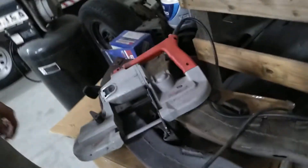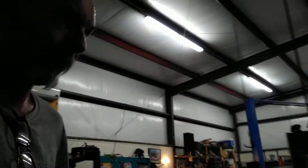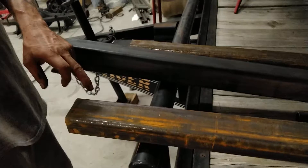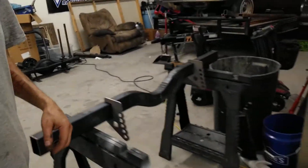...but the two by three box tubing over here is going to go in. Then we're going to clean up these original frame rails which are right here, and mount them to the top of this two by three tubing. The two by two will be roll cage mounting parts along with part of this three-sixteenths for the front of the cage underneath the passenger compartment. Hey, we got the cross member we've been waiting on — very very cool.